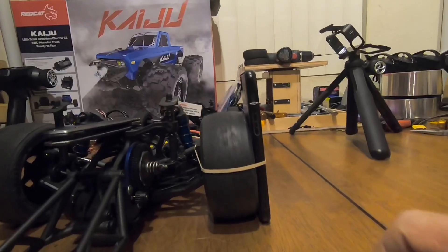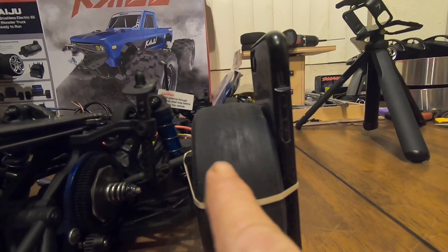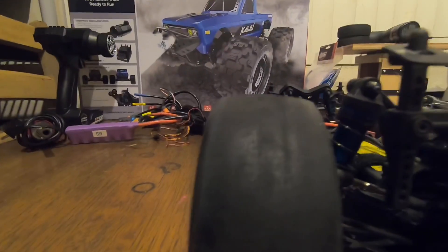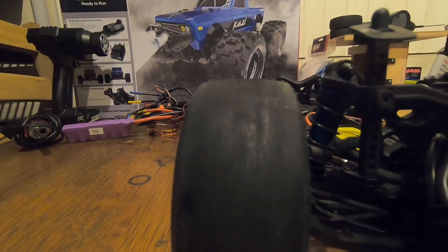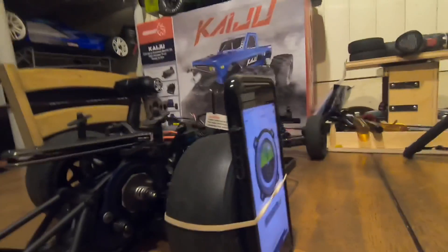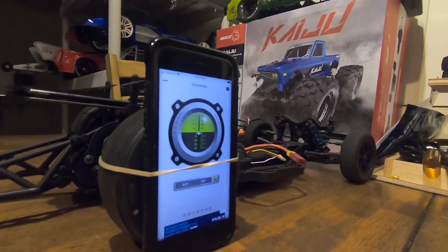I'm working on this tire patch because my wear is only from here to about here. My other tire, as you can see, is doing pretty good but still not to the inside edge. So that's letting me know that when this tire's growing, my camber's off.